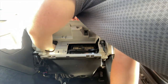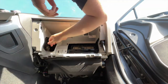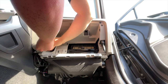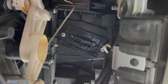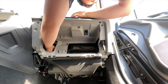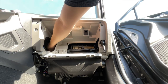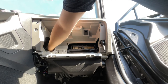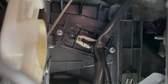The whole project took about 20 minutes for an inexperienced person like myself — that's just feeling it out and being patient. You want to get the screws in nice and tight. It might feel like you're over-torquing, but if you tap the resistor and it still flops around, keep tightening — just make sure it's not cross-threaded. You want it snug so you don't get vibration while driving. I used my phone as a flashlight since the sun angle wasn't favorable. Once it's snug, the wiring harness just pops right in. There it is — wiring harness and all in place, looks just like the original.